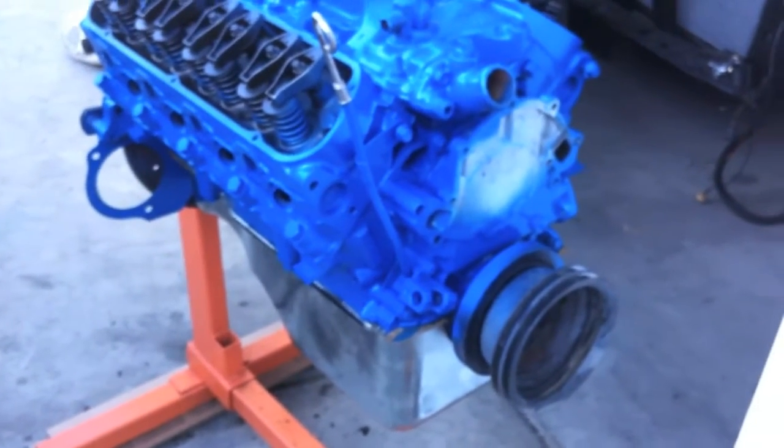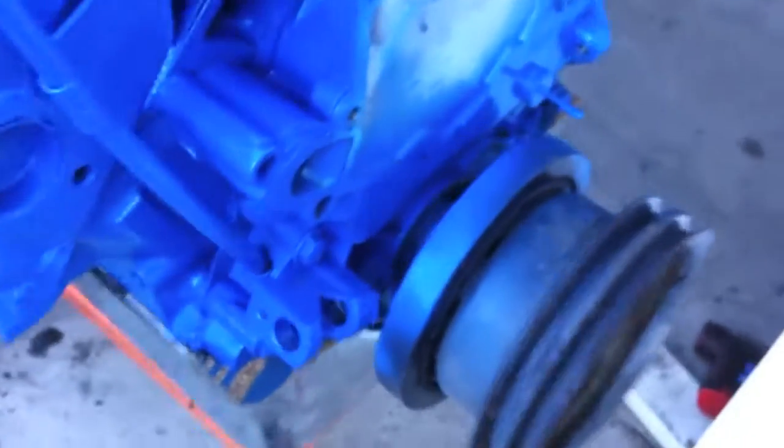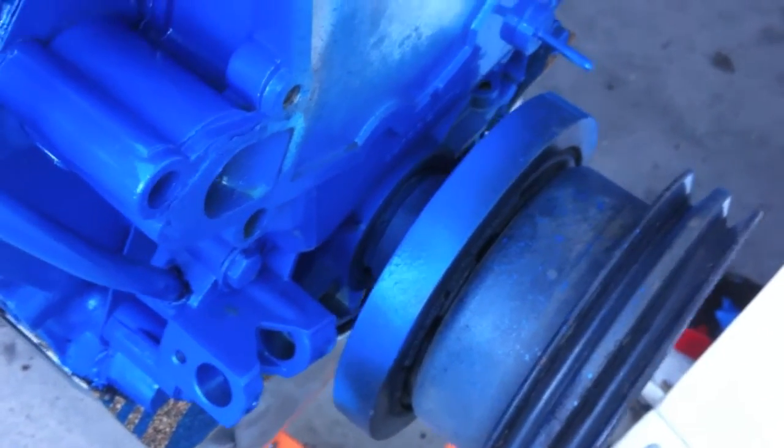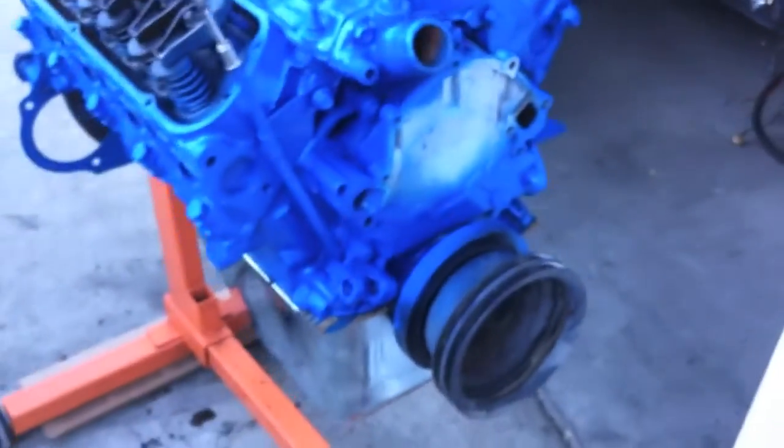Give me a call tomorrow. I'll email this video to you so you can see all this coverage on the engine today, and let's talk about it. Let's get a harmonic balancer. I'll get prices for you, and let's just change the front and rear mains. That's an absolute. I'll send you a new estimate for that work to get it done right. You'll have good gas mileage because you're sticking with the two barrel, and she'll be sealed front and back. Very important, correct? Very important. What do you think, Carlos? Very important. Carlos agrees.